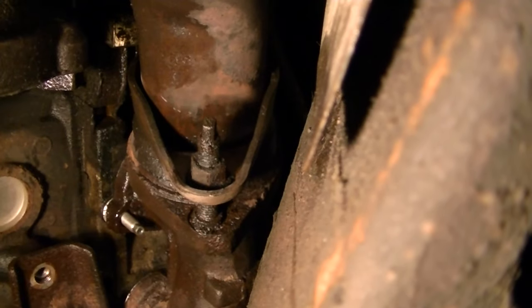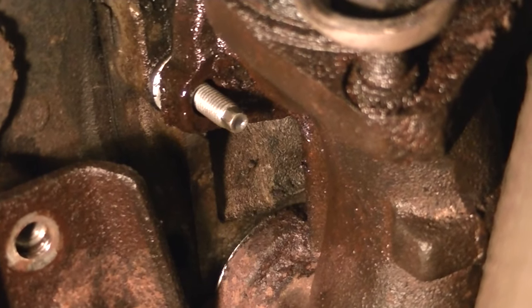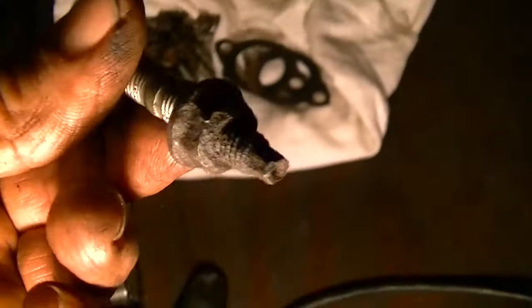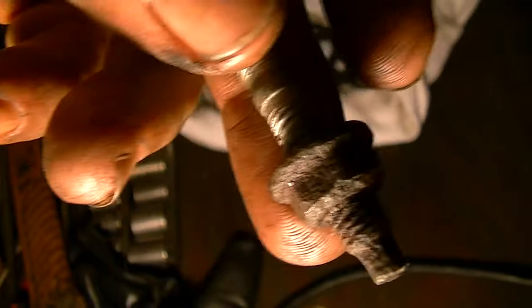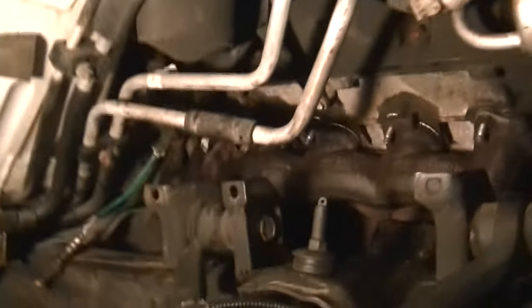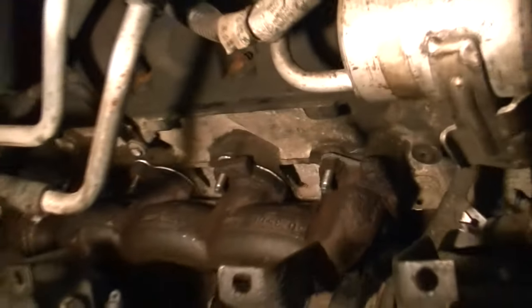The flange gasket is just fine, but if I tried to take that nut off it would just break that stud and open up a can of worms. A lot of times these bolts on the manifold don't come off easy — you end up twisting and breaking them. I've broken lots of them before and you sometimes have to tap them out or in extreme cases pull the head off. That's why it's very important to get a good grip on those bolts before you take them out. The key is to get a good firm socket on that rusty stud and it should come off. Forget about trying to tap the top of the stud — that will almost never work. Just get a socket on there to break it loose. All I've got to do now is tighten the bolts down, put the O2 sensor in, put the starter on, and we're done.